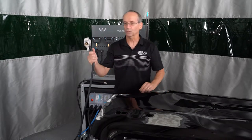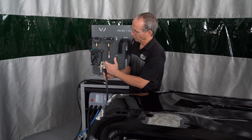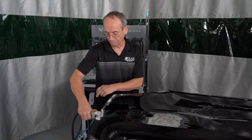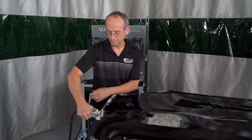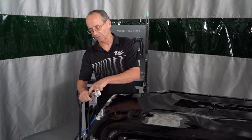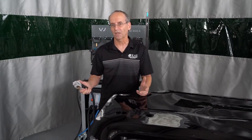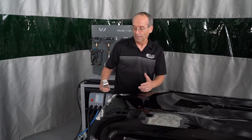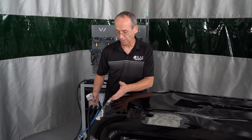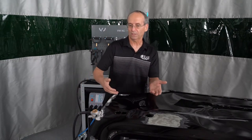We're going to be talking about hooking up the ground cable — a couple of different ways on this. We really want the point here to be on our ground, onto the bare metal. If we do it incorrectly, everything is going to try and travel through the little pivot pin. So for welding, we always want to make sure we have as best a connection as we can for good ground to the material. On this door, we have a little bit of bondo from a previous repair. I can clamp this on here and we have our ground set — we can actually start doing our welding.